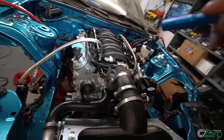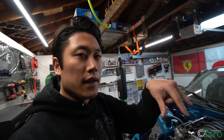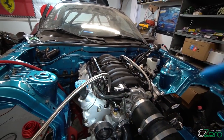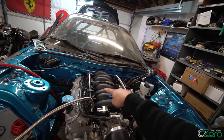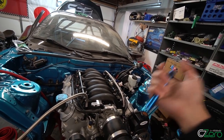Another thing I did here is the steam port system. LS engines come from factory with steam ports on top — two in the back and two in the front. The two in the back of my car were capped off, and the two in the front were hooked up to the radiator inlet from the factory. The theory is that once the engine gets hot and coolant is somewhat evaporating, steam is generated and needs to escape. Because the coolant inlet and the cylinder head are at different heights, steam can get trapped in the cylinder head. So what a lot of people do is connect these steam ports together so pressure can escape the system and you don't damage the head.